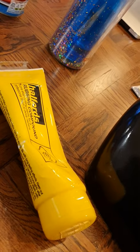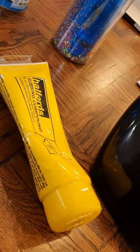That's the wing mirror painted with the black Z11 paint. I've used the lacquer to coat it — about three coats of lacquer. I'm going to use a rubbing compound with a wet cloth to remove some of the orange peel. You can clearly see it's got a bit of orange peel on it. The light is picking up some sparkles which are deliberately meant to be there. My next job is to polish this down and remove some of those orange peel effects.